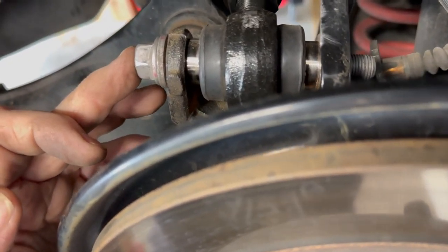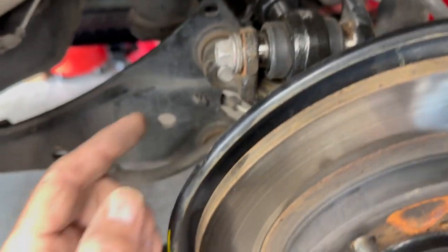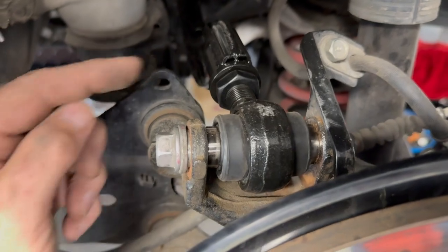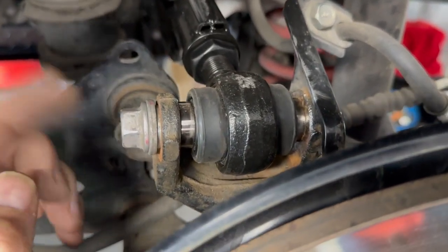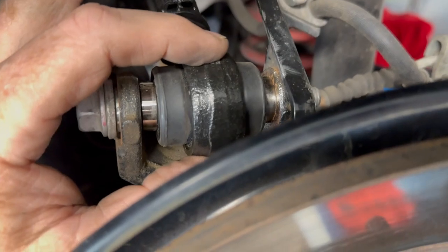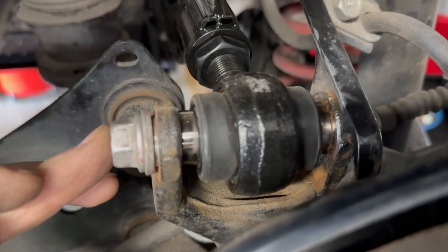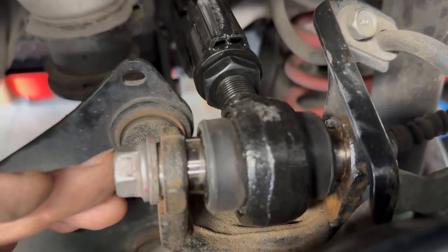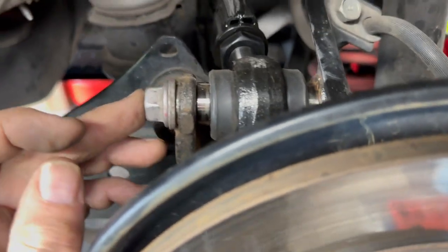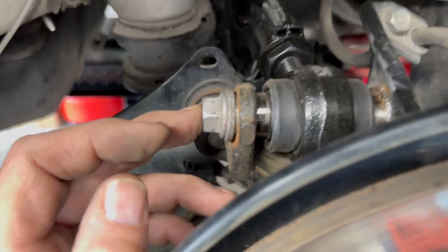And this will be done. The one thing I was noticing, though, is to adjust this. I wish you didn't have to undo this, but you actually have to undo this bolt right here and then lift this up so that you can turn this with those threads here, and then put it back in and stick the bolt back through. Which really isn't that big of a deal. I undid this by one full rotation to make it a little bit longer. I don't know how much that is, but I'm going to do one full rotation on both sides,